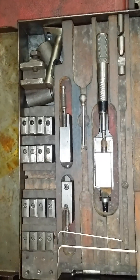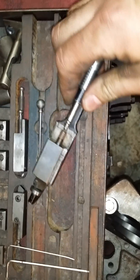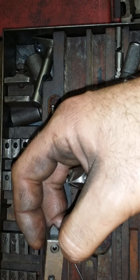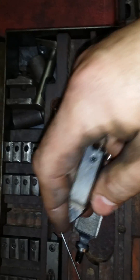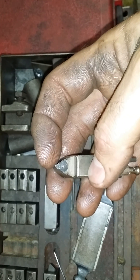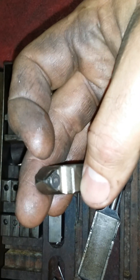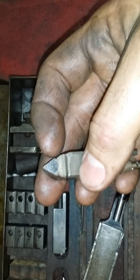The number threes are what's in the machine now and I use those 99% of the time. I've got several of the old cutters here but I never use them — I purchased a Lacey Williams Super 6 cutter instead. The old bits you would actually have to sharpen that point. The Lacey Williams does away with that — they've got replaceable triangular bits, three on each side making it six-sided. You can do many, many cylinders on one point. When it gets dull, you either turn to another corner or flip it over and go on to the next hole.